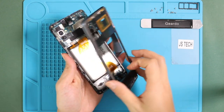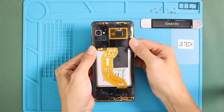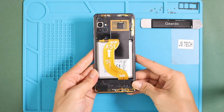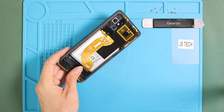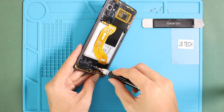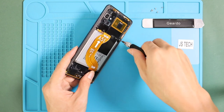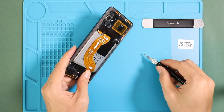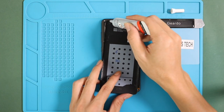Restore the rear car frame and make sure the clips have tightened enough and insert all 13 screws back. Before installing the main back cover, make sure it has enough glue on it. If not, use B7000 glue or new double-sided back cover adhesive.